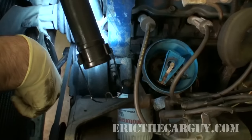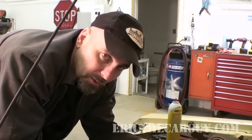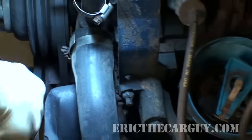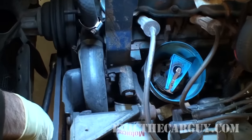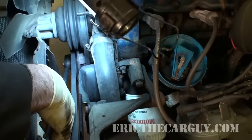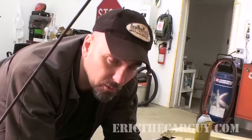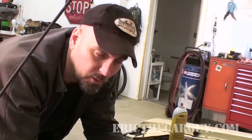It just started to move there — looks like we're right at seven degrees. Just to confirm this, I'll rotate the engine back a little bit, bring up the timing mark, and show it to you again. It looks like this timing chain is getting a bit worn out. Okay, it's right down on zero. Now I'll change direction on the ratchet again and rotate the crank — keep an eye on when the ignition rotor actually moves. Okay, it started to move right there. Once again we've confirmed that it looks like it's moved about halfway, and I would say I'm right on the border of this timing chain having too much slack in it. When I pull this engine out I'll take the timing cover off and see if we can confirm that slack is indeed there.